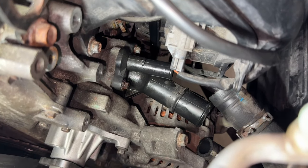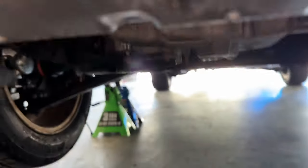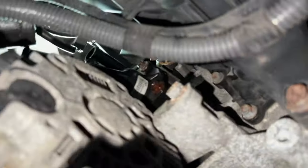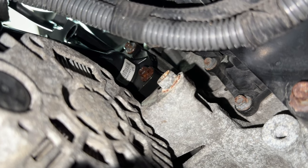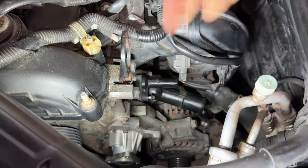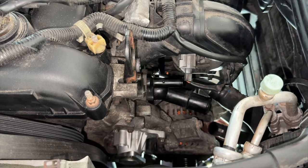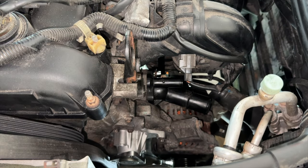With the two tubes removed, all that's left are three bolts. You can see the top two right there, and the third bolt is underneath the car — it's very easily accessible from below. I already lubed them up with WD-40 so they should back out easily. The bolt closest to you is accessible from the top; the other two were a bit of a pain and I found it easier from under the car, though I've also seen videos using an extension from the top.